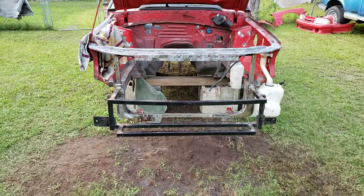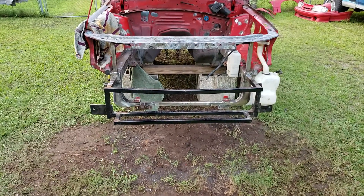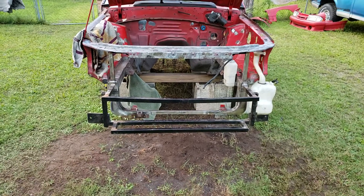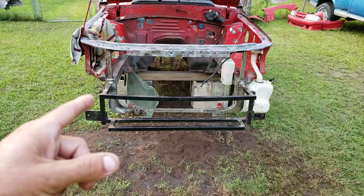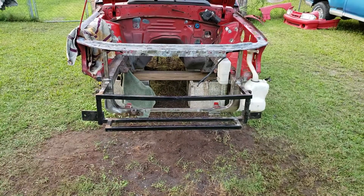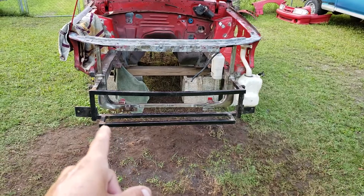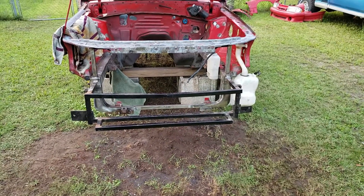Here's an update on the front radiator support. I'm getting rid of those bars that were underneath for supporting the bumper to the headlights, so it's nice and flat - I'm cutting those off. I'm making new brackets and switching those out to aluminum. These two lower black bars are going to get new brackets made and switched out to aluminum to make it a little bit lighter.